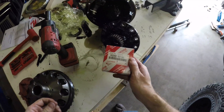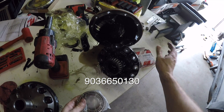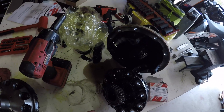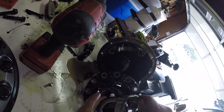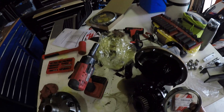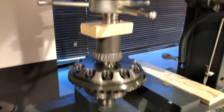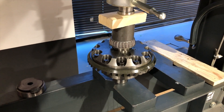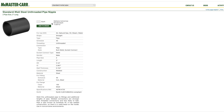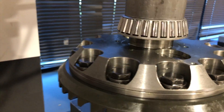Before you start, you're going to need new bearings. ARB is not super clear about this, nor which bearings you need, but you do need them — here is the part number. These are 50mm inside diameter bearings; get two. You might be able to pry off the old bearings and press them onto the new diff, and I like being cheap, but I don't recommend being that cheap. Before you start tearing apart your differential, press the new bearings on. You'll need a press for this, and a short piece of pipe with an inside diameter of 2 inches. If you don't have anything lying around, just go to McMaster and give them $11 for this part number. You can use just about any hydraulic press for this, but you do need a press.